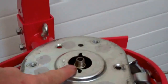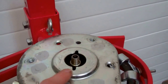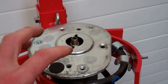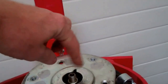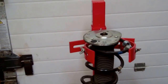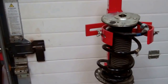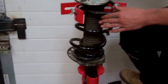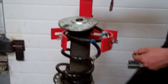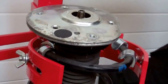You can get more simple ones that just have a bit of threaded bar and clamp it up, but we thought we might be doing this again. So we're going to have a go now at compressing the spring. We need to compress the spring and then we can remove the nut on the top end. Obviously if you remove the nut and you haven't got the coil spring compressed, it's really quite dangerous because it can all ping off on the last thread - all the energy stored in the spring is going to launch that top mount everywhere.